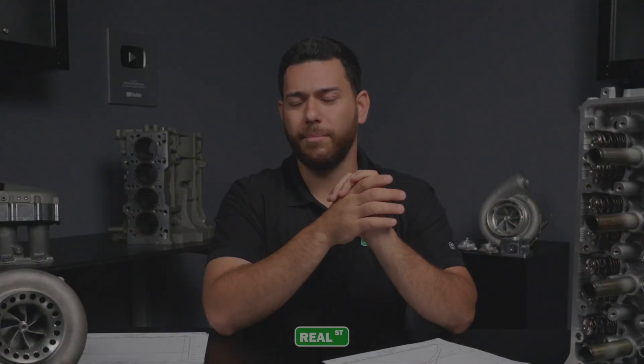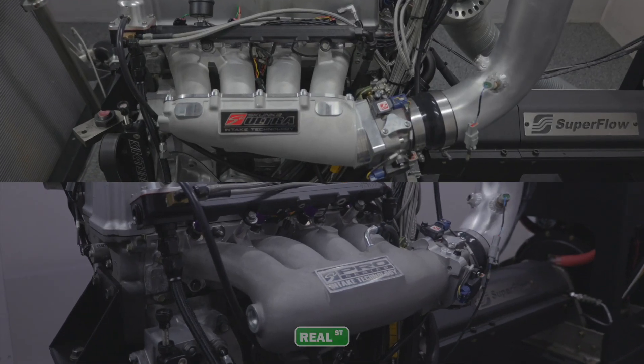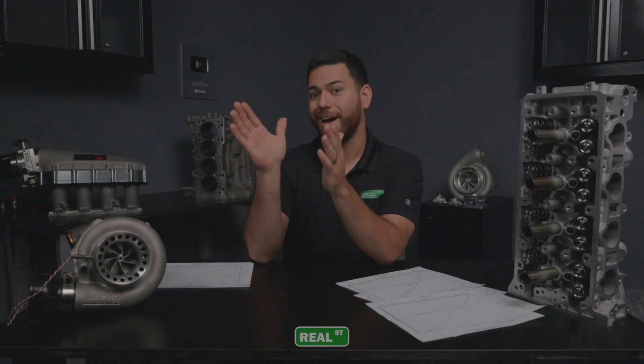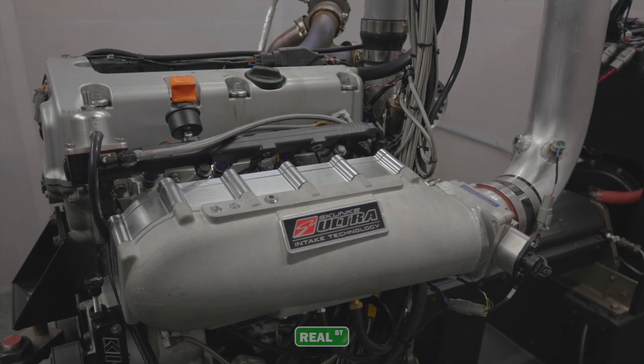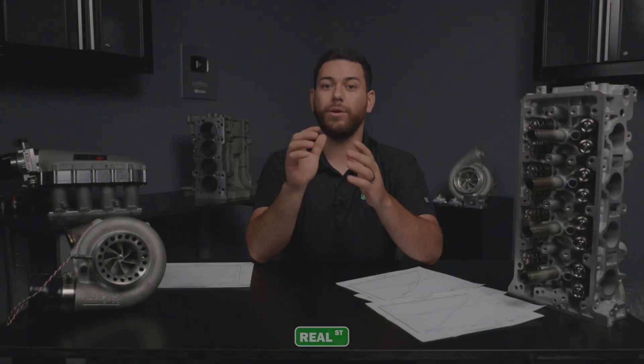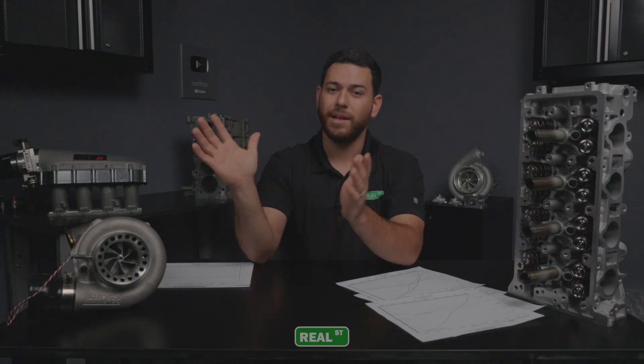What does that tell us for your selection at home when going for an intake manifold on your turbo K-Series? If you're trying to stay very fast on spool and want as much torque down low, the Ultra Street and Pro Series manifold might be a better selection. If you're a dedicated drag car that will only live at higher RPM and don't care that much about low-end torque, then the Ultra Race might be a better selection. But we haven't touched on exactly where the Ultra Race shines the best just yet — this is a completely stock K24 engine only making in the low 500 horsepower range, and if we were pushing somewhere in the 900 or 1,000 horsepower range, these tests would likely be vastly different.